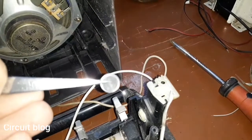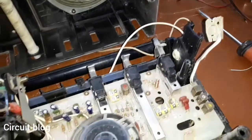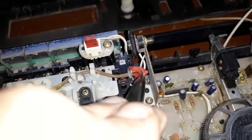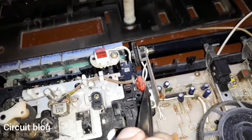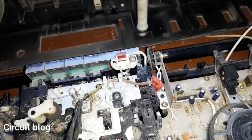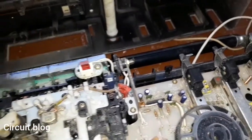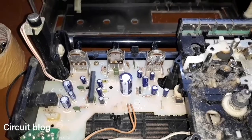Here is the mic and it looks like it is broken. Also in the tape mechanism there is a lot of dust and dirt. It also appears that someone was inside this unit at some point in the past and messed with the shielded coaxial cable — the shielded wire that connects the audio head to the amplifier section on the main board. He must have cut the wires and taped them together, which is really bad. Also the variable resistors are dirty as hell.